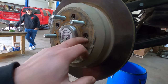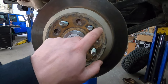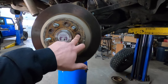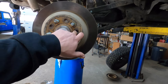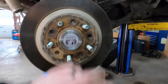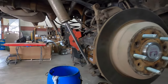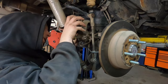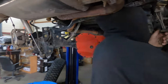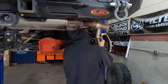You'll notice that the Yukon rear axles actually have a spot for that one bolt that would go there. From doing a lot of work on this Jeep, at one point I probably forgot to put that back on. So if your Jeep's equipped with it, you can still use it. You're just going to put your two 18-millimeter bolts back in for your caliper and you're done — throw your tires on and top off the rear diff. The axle job is officially done.